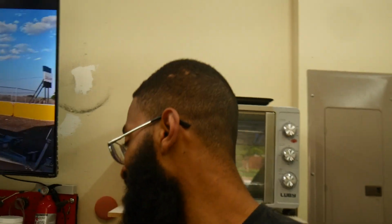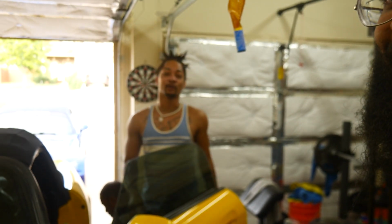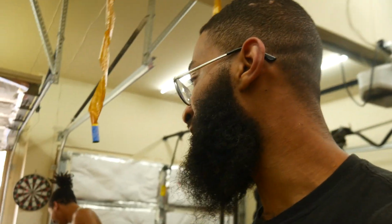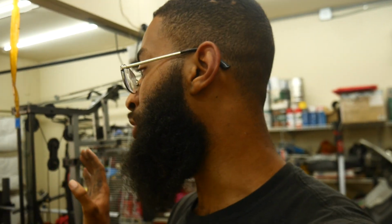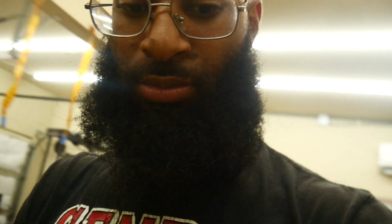All right, guys. So we're kind of running into a little bit of a problem. My brake system. I have not done the brakes since I got the car, unfortunately. Unfortunately, I haven't been taking care of the car where I should. So we're trying to fix an issue with the caliper pushing it in. I'm doing the pads on the rears, and then in a month or so, I'm going to do the front pads. So we're trying to get the driver's side rear piston in. We're having issues going in, but luckily enough, we're bleeding the system anyways and changing the fluid.